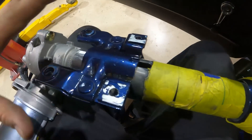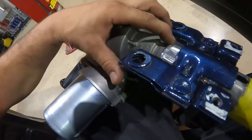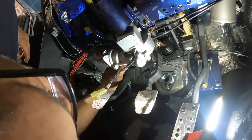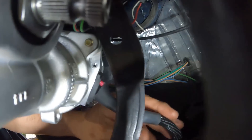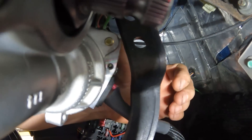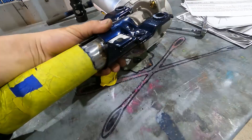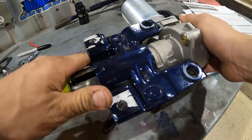I have the motor mocked up to our modified column housing and the mount bracket. I'm going to put this up there and mock it up to make sure I have all the room underneath the dash. It is fairly close to the clutch pedal — you can see the small air gap right here. I'd rather see it a little bit further away, so I slid the bracket further down to draw the motor up closer to the bracket.